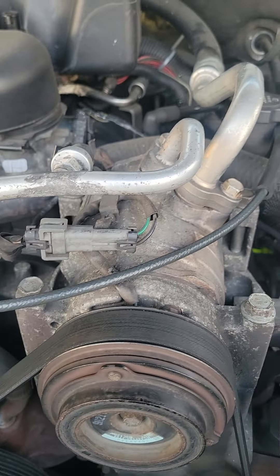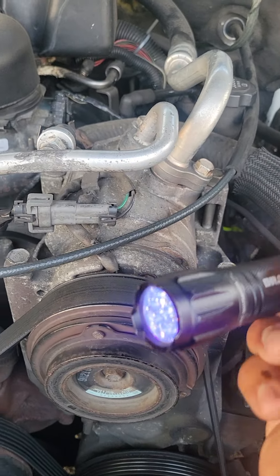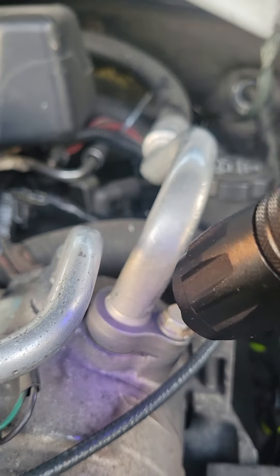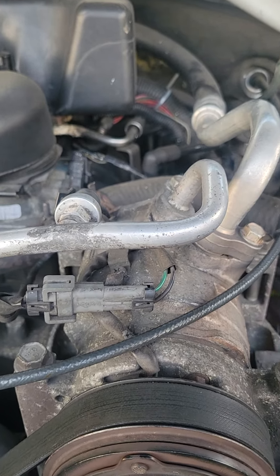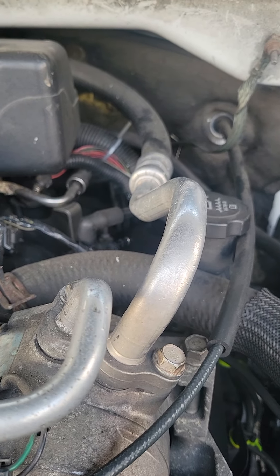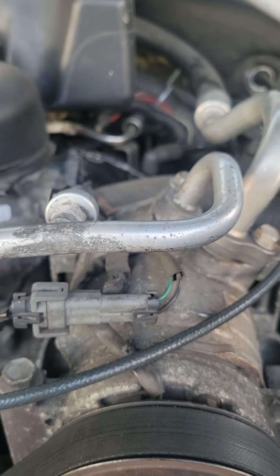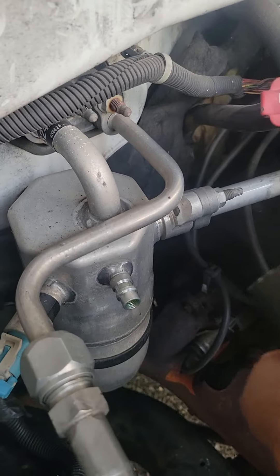After a couple of days of running your air conditioning system, get yourself one of these UV lights from Harbor Freight, Walmart, or your local auto parts store. Look at every visible line and hose within your air conditioning system — what you're looking for is some sort of leak or dye that glows. Keep in mind you can have a hole so big you'll hear the Freon coming out, or you can develop a very small hole on the back of an aluminum AC line and never know it's there. So make sure you check every visible part of the system.